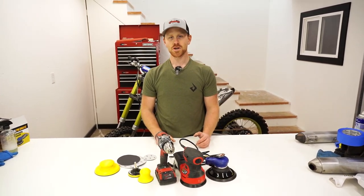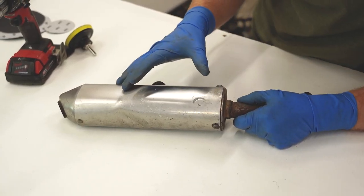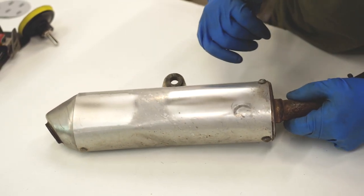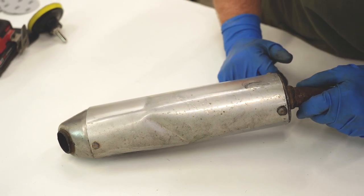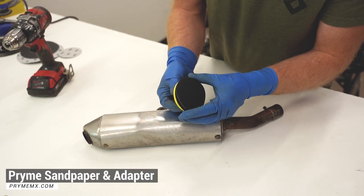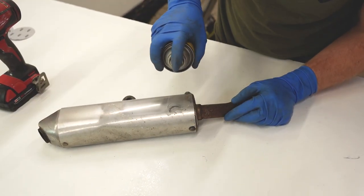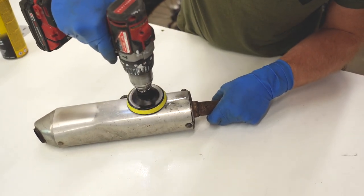Today I'm going to show you some of the best uses I've found for sandpaper. We're going to sand out some scratches in this aluminum silencer. We've got a pretty deep gouge right here — that's going to require starting with 180 grit, whereas some of these finer scratches and pits I would start with 320 or 400 grit. We're actually going to use this on a drill, so we've got a drill adapter pad with a hook-and-loop, kind of like a velcro attachment. Pop it into a drill, and I found that sandpaper usually works best with some lubricant, so I sprayed some Maxima MPPL on here and get sanding.